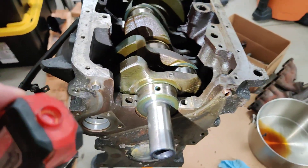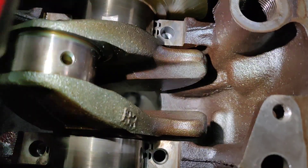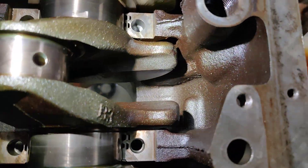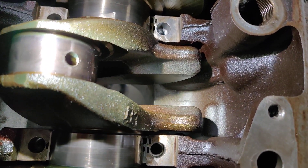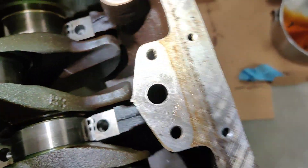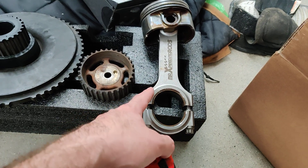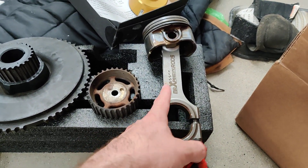The other thing is, depending on what rods you use, you need to check the clearance on the bottom of the bore right there. If you have OEM rods that are not M54 — like if you were using the E30 M20 B25 rods, the 135mm — they will hit down there and you have to clearance that. But in this case, with an aftermarket forged rod, they have a pretty big scallop right here, and that actually clears really well on this particular setup.